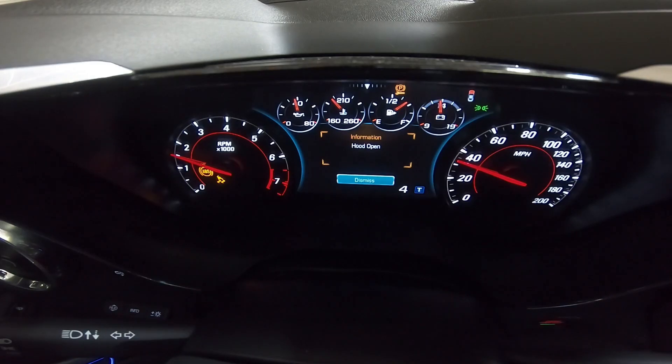That should be able to add almost max timing. Obviously we're gonna play it a little bit safe and have it add probably two or three degrees more overall running right now, and if it likes it we'll bump it up a bit, and just wait till we go full E for the rest. I'm pretty excited, we should be seeing some solid numbers.